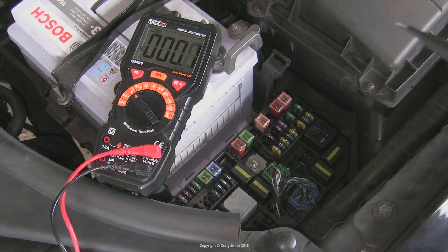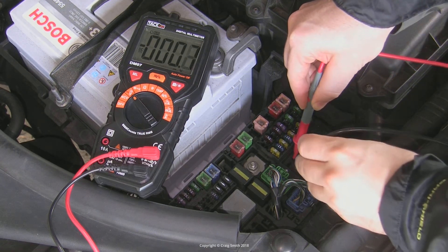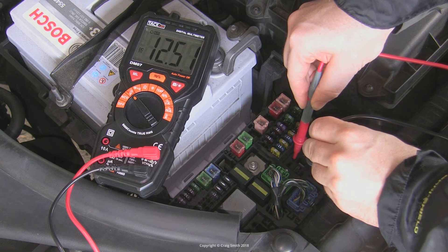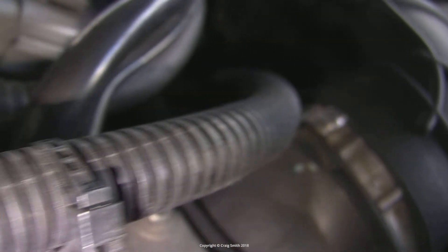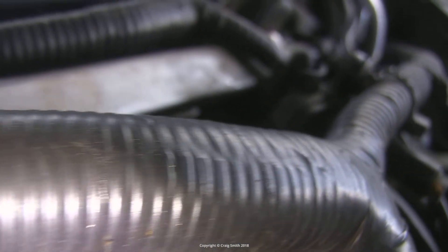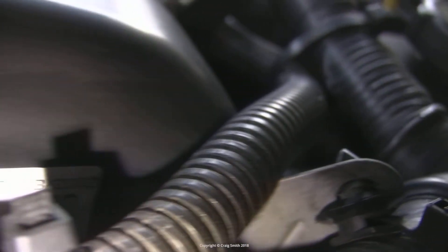You would also want to check the fuse box — find an open fuse or a relay that's live and check that there is battery voltage at its plug terminals. Here you might find fusible links blown or damaged, which can create problems that look like a bad battery or alternator. At the same time, cast an eye over the wiring to look for any obvious physical damage or burned cables.